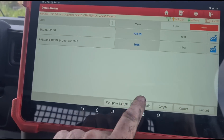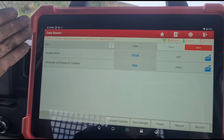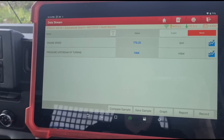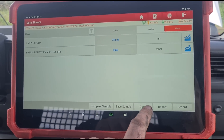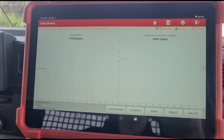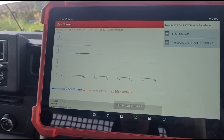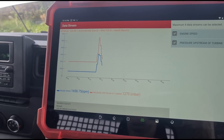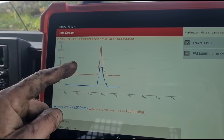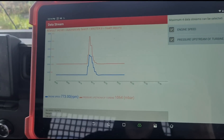With this being a Renault, the next thing we're going to check is the upstream pressure sensor. There were some other faults regarding DPF pressure, but they've been cleared so the customer could drive it down here. We're going to look at what else is going on through the live data — just because there's no fault codes now doesn't mean someone hasn't been clearing them. We're checking if the readings look correct. We're looking for the charts to look very similar — if the blue chart goes up and down and the orange chart gradually drops, then you know there's a blockage.